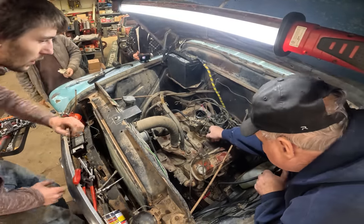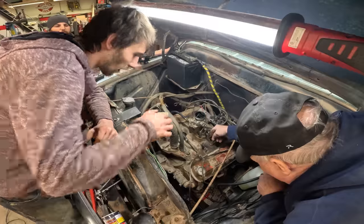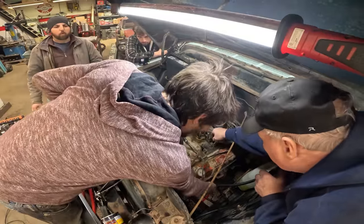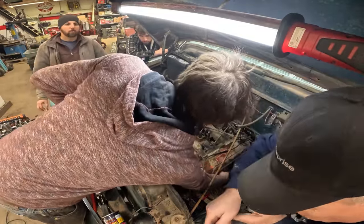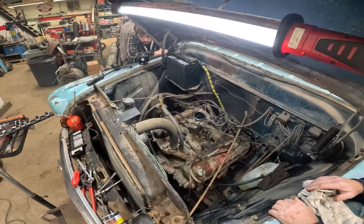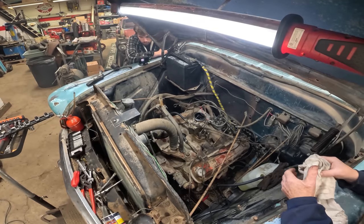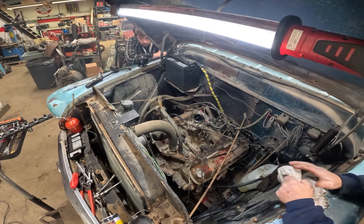Yeah, we do. Or cross wire. That could possibly be a cross wire. Okay, let's shut the key off and check the firing order. I put them along the same way that they have them, so they very well could be crossed.